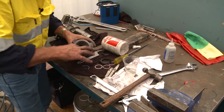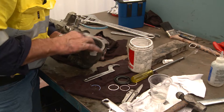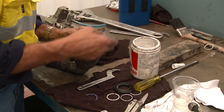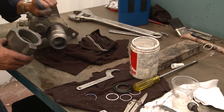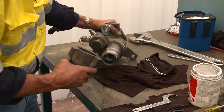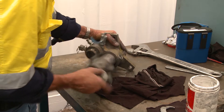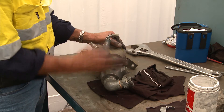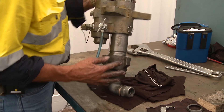Run a little oil up around the top to assist with lubrication, a little bit of vaseline, and squeeze the remaining anti-seize around the thread — that is good to go back on. Don't just leave that ring land exposed to damage: put the foot valve back on there without necessarily tightening it fully, so you know your shims, ball cage, ball, seat, and all o-rings are safely inside. As far as this pump is concerned, we've rebuilt it.